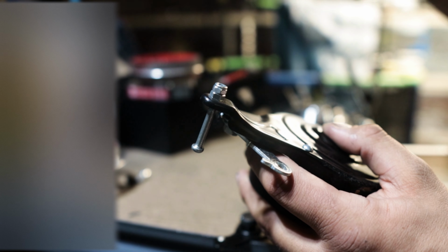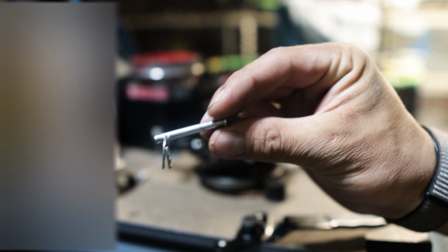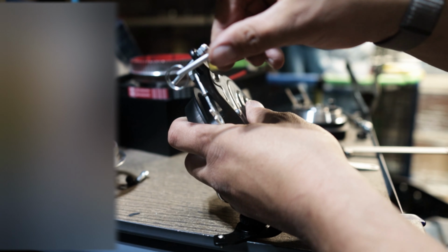For the top, you're going to need this guy. I use a pin actually, I'm just going to trash this, and I use a pin going through the forks; cut a hole in your forks. This will hold the top of this assembly onto your forks, and you could take off this cotter pin for quick removal. I got this at Ace, and this is about 0.18 by approximately 1.4 inches.